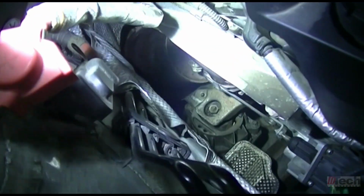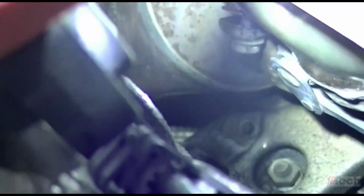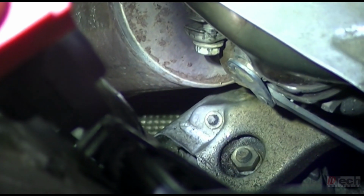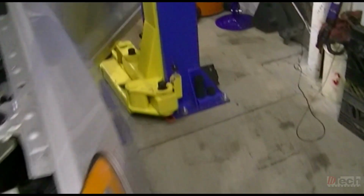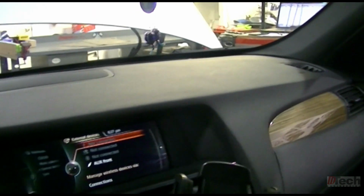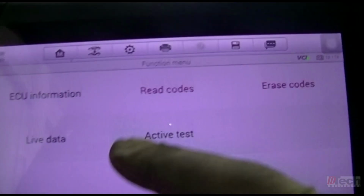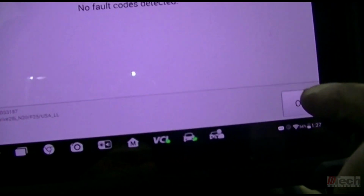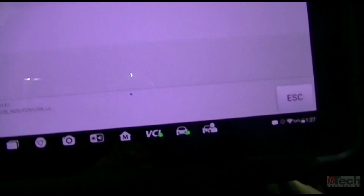Okay, so went ahead and put the bolt back in, and it appears to be good and out the way. And then I'll do one last recording capture, key on, and make sure no code comes back, and we'll do startup and running also. There's that. So key on, goes through its flight check deal, and still no code, so that means that clamp and bolt are out of the way far enough.